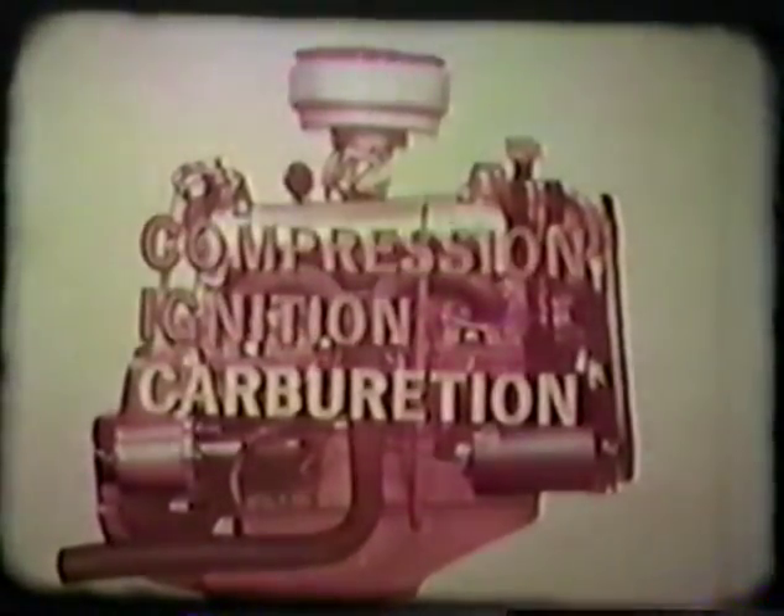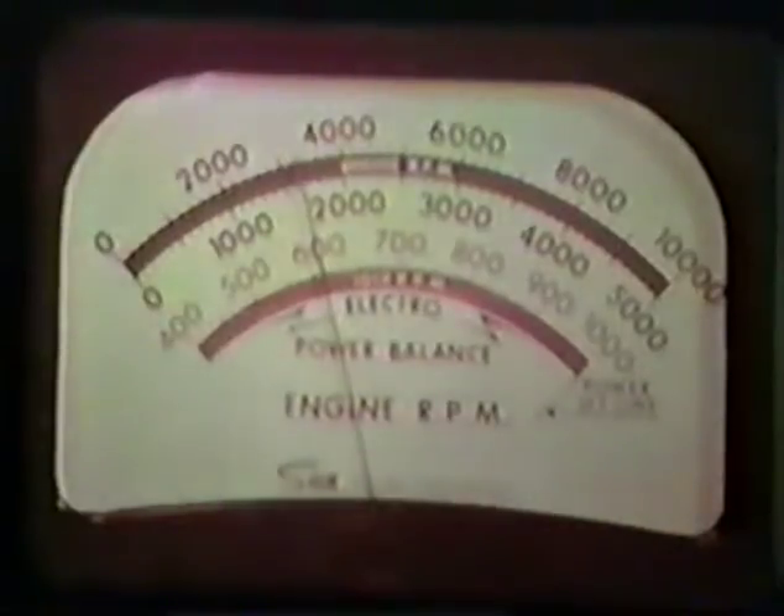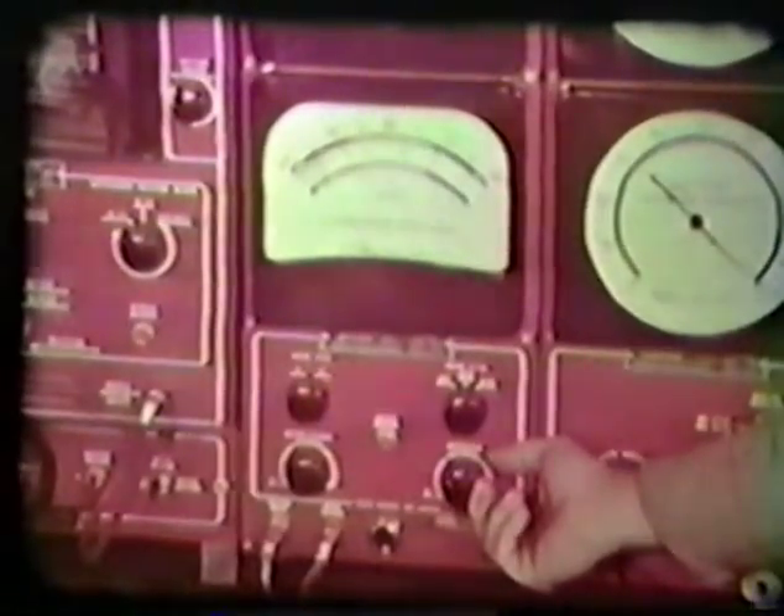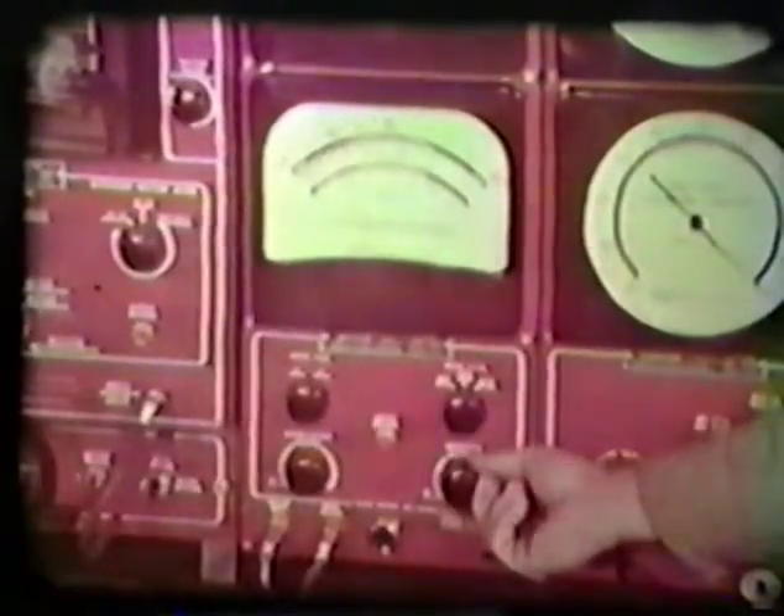The final factor to be considered during engine tune-up is carburation. An engine's carburetor automatically controls and delivers the right mixture of air and fuel to each cylinder. Improper carburetor operation can cause a rich or lean air-fuel mixture, which would cause poor engine operation and accelerate engine wear. Combustion efficiency testing is a reliable indication of carburetor system operation on a mechanically sound, properly timed engine with a good ignition system. With the engine warmed up to normal operating temperature, check the RPM and adjust as necessary — it may have changed slightly during the ignition phase of tune-up. Next, turn on the combustion efficiency tester and allow it to warm up. When it has, calibrate the meter to the set line.